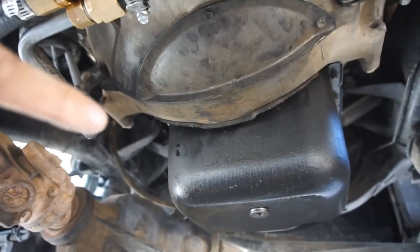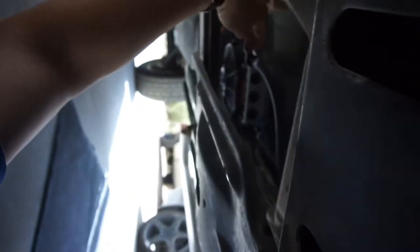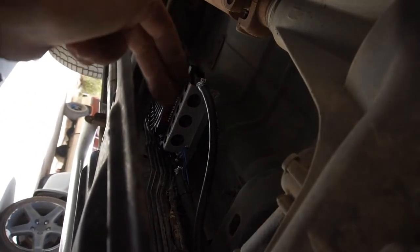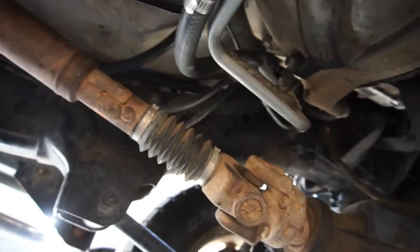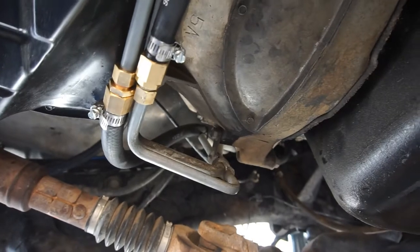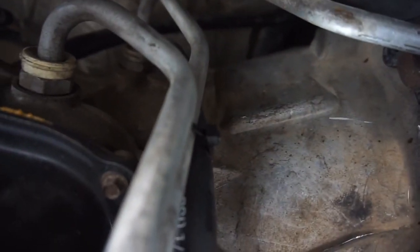So this way, because the tranny cooler up front, the clutch fan will turn on at 210, this will turn on at 180 back there where we were at. So that'll turn at 180, so that'll cool it. At least it's 180 degrees either way coming in. But yeah, and then I just got it as far away from the exhaust as I could, which is up in there.